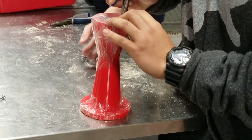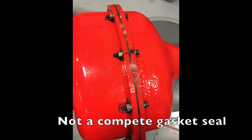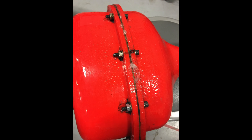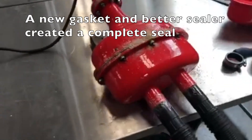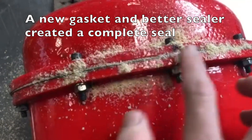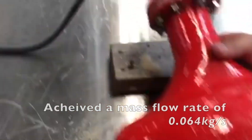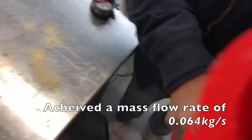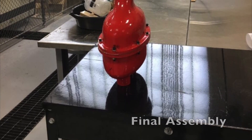We ran tests to check for air leaks. Initially, we tested with a pressure of 20 psi and we experienced air leaks at the gasket junction. We solved this by purchasing a better gasket sealer and another gasket. In the next vacuum test, we managed to get a mass flow rate of about 0.032 kilograms per second per vacuum hose, so about 0.064 kilograms per second through the entire restrictor. We noticed no air leaks from this test, which makes us feel very confident about the piece moving forward in the car.